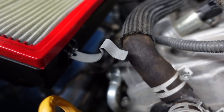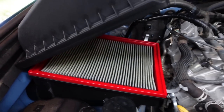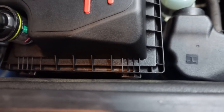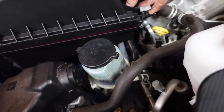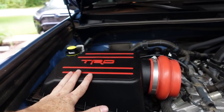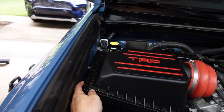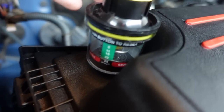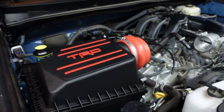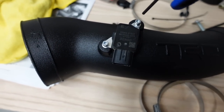The clamps hook underneath and pull up. Then take your intake top — there are hinges right here — and it rests on those hinges. It closes forward like so, and you latch it right there. It's a pain to get on and off, and honestly the plasticky flimsy hinge design from Toyota is annoying. That's probably why they give you the filter indicator — to tell you when the filter is bad — because it is a pain to access. Don't forget to remove your mass airflow sensor from the stock tubing and tighten it onto the TRD intake tube.